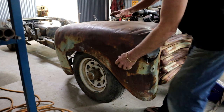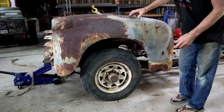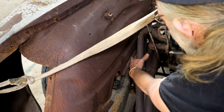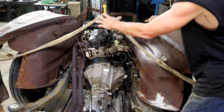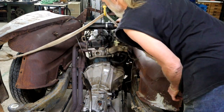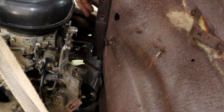It's better now. I've got my wheel basically in the center of the wheel arch - same this side, wheel is more or less in the center. This side is too high still because I'm still fouling. From the front view you can see it sitting all skew because on the left-hand side the inner fender is catching right there so I can't drop down more - I need to do a little bit more surgery. But at least you can see it's fitting nicely around the engine. I can retain the inner fenders, it's clearing pretty much everywhere. Got clearance by the header. The inner fender is tight against the alternator here - we can just create a dent in the fender with a big hammer to get a little more clearance. So that's not the end of the world.